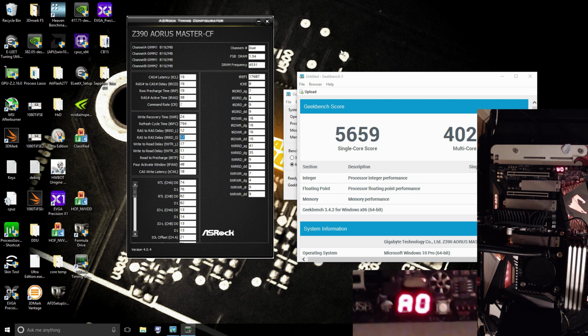There's a distinction between which row to row delay, like RAS to RAS delay it is, so there's a physical meaning behind the timing. It's not just long and short, but if you're just lowering the timings, generally you can just think of them as long and short. As in, short goes lower than long does. And the same works for TWTR and TWTRS as well. Those two do that as well.